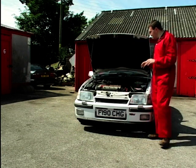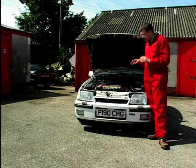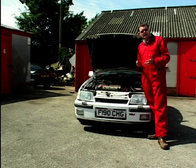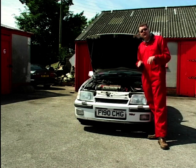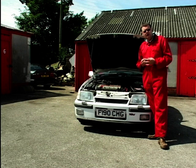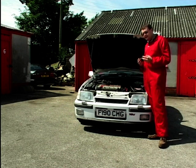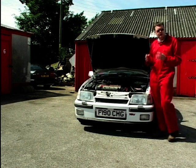This is quite sporty and it's got quite a complicated fuel injection system on it. The symptoms with this car are that it's sort of cutting out at junctions, does what it wants, hunts a bit — revs up and down, almost uncontrollable. You could be fooled into maybe spending a lot of money at a garage replacing some parts, but in reality this car has a thing called an auxiliary air valve or an idle speed control valve.